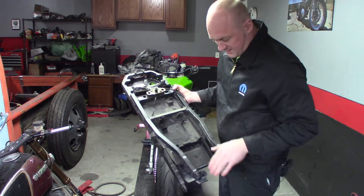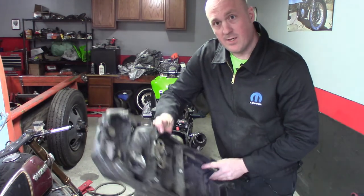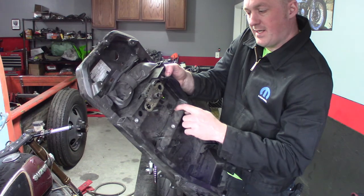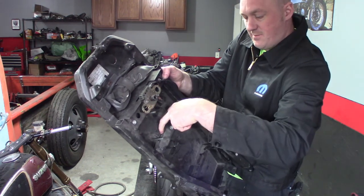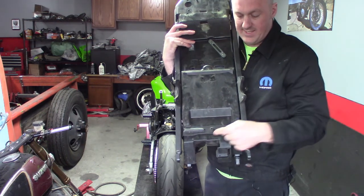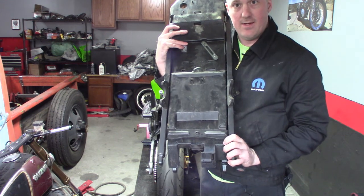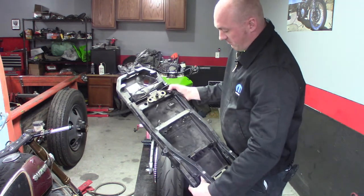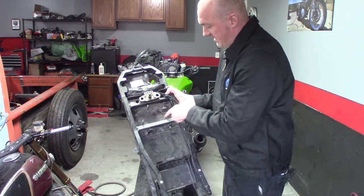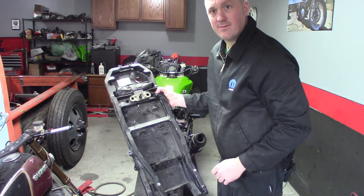This is great news. It looks like it's a very simple setup on how this is mounted. There's a crossbar up along the top edge that's got two slots cut into it that this thing slides into, and then on the bottom is just a flat piece across that has a hole drilled in it for a centering dowel, and then this plastic piece just sets right in there. That's very easily something I can replicate on my subframe, and that's exactly what I'm going to do. I'll probably cut it just right back here after these mounts.